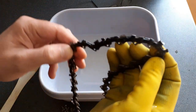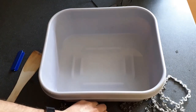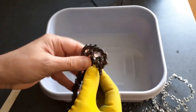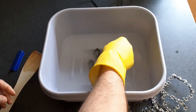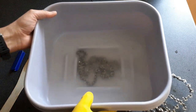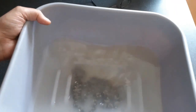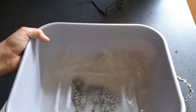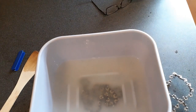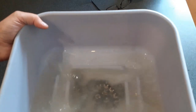Let's find a bad chain — that one's not too bad, that one's quite clean, that one looks a bit gunky. Okay, so take the chain, we're going to drop it in. The reason I have the gloves on now becomes apparent — this water is hot. Now I don't know if you can see, but straight away that dirt is starting to dissolve out, that grease is beginning to come out. Can you see the change in color of the water? I'm going to put the lights on — it's a sunny day but the lights might help.